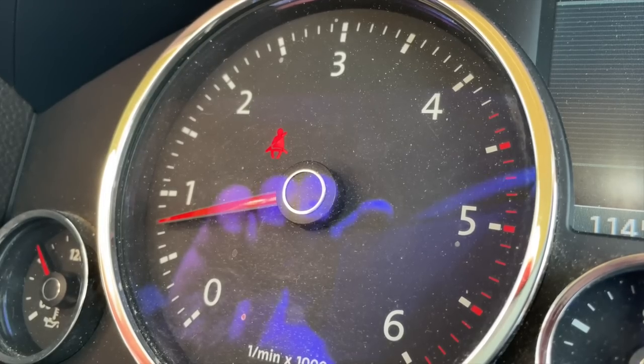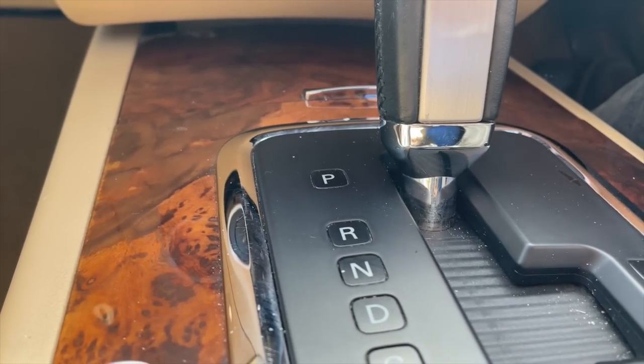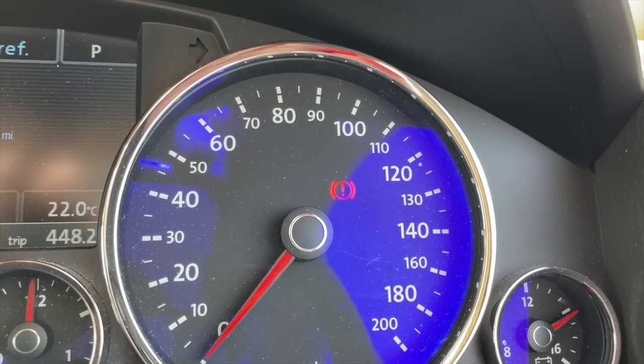In the car, I should have the caravan hitched up, the electrics plugged in, the car switched on — in park if it's an automatic, in neutral if it's manual — the handbrake is on, everything ready to literally just pull away. So the car is in running condition. What I'm going to be doing is selecting each one of the lights — the indicators, the brake, the reverse, the fog lights, and the side lights — and then we're going to finish up with everything on to load the system up correctly. I'm not going to tell them what I'm going to be doing; I want them to tell me what they are seeing.